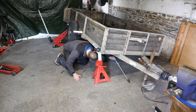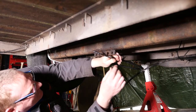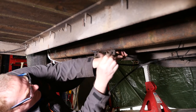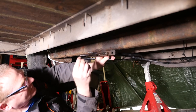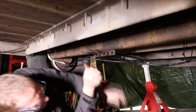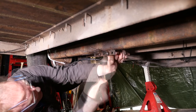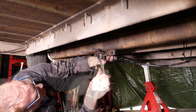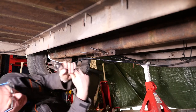We'll go under the trailer. What we must do first is attach the two cables and the two cable abutment nuts — pop those on. I'm making sure the cables have a nice smooth run with no tight turns, and I've used cable ties just to hold them up to the bottom of the trailer. We'll tighten these abutment nuts up now. This one kept spinning so I had to use a pair of mole grips just to hold it so I could pinch that abutment nut up tight.